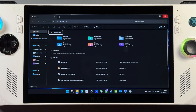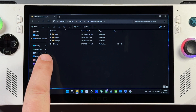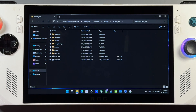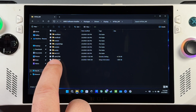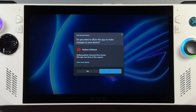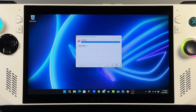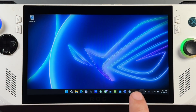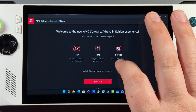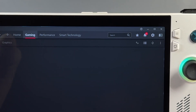Now we need to install AMD Adrenaline, because it won't be automatically installed since it's not an official OEM driver. Go back to the C drive and that AMD folder: Software > Installer > Packages > Drivers > Display > wt6a_inf folder again. Find the folder labeled something like 'b4' or a letter-number combination near the bottom — go in there and find the ccc2 install. Run that and it'll install the Radeon software. This might take a couple of minutes. Once done, click Close, then restart the device.